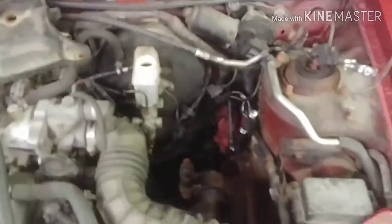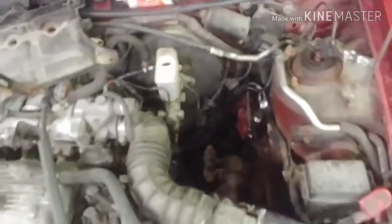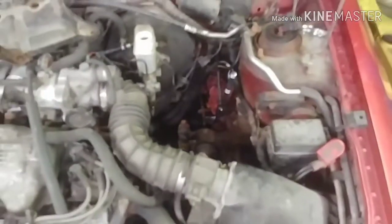So I'm going to swap it out, throw on my little vacuum Mighty Vac brake bleeder, crack the slave open, dump some fluid, top this up completely to the lip of the reservoir, and keep that completely topped up while I vacuum it out, and then tighten it up, top it up again, and see if I get a pedal.